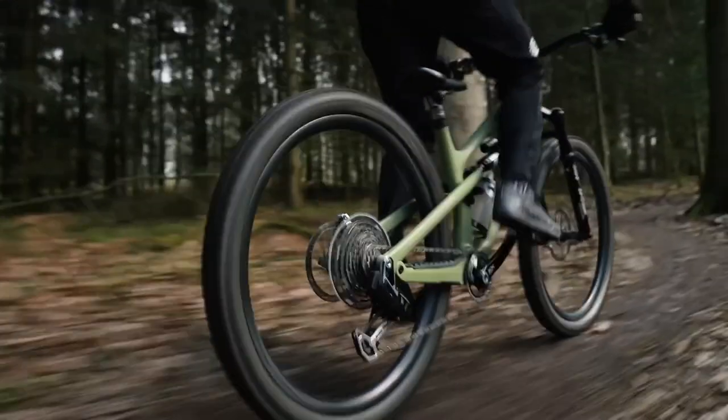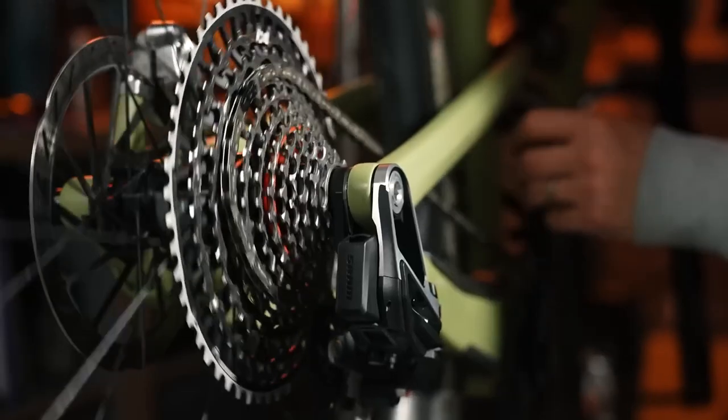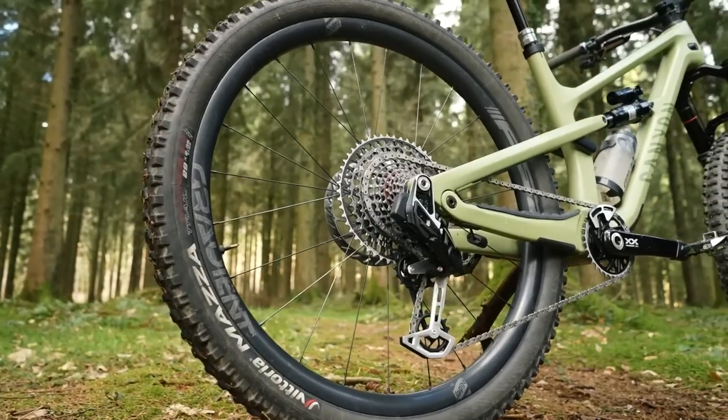A derailleur underneath is actually quite a good design. The pulley wheels and derailleur move as the cassette rotates clockwise, feeding the chain so the cassette picks it up with the teeth and pops it on top. If you think about pedaling and pulling on your chain, the tension is at the top. So if the derailleur were at the top, the chain would be coming from underneath and kind of pushing into the derailleur as it moves, and the tension from the pedals would actuate the tensioner — it would all be a little bit messy.